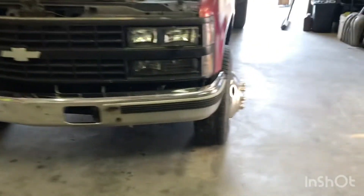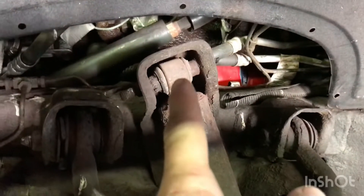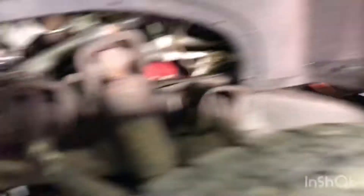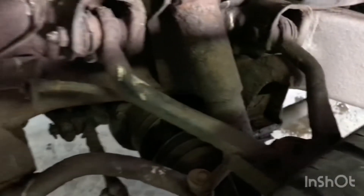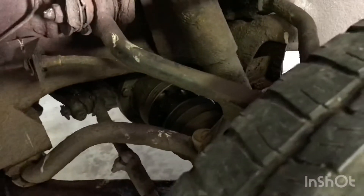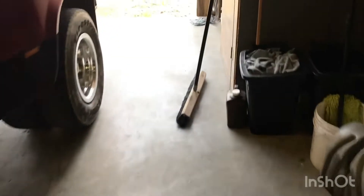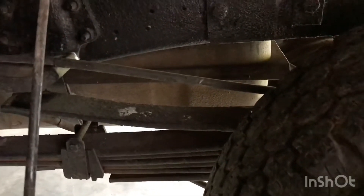We still have to finish up some things. I got to put that front piece back in yet. I need to do some front end work on it if I'm gonna keep it. I'm probably gonna take the shocks off the '98 - the Rough Country ones - and throw them on here. I got to do a CV axle boot down there, it came off. I'll probably do new upper and lower control arms, new sway bar end links and bushings. I think you can get a whole front end rebuild kit - ball joints, tie rods, sway bar end links - all that for like 150 bucks. It's a one-ton dually, so it's got the nice heavy-duty leaf spring pack with the overload spring.